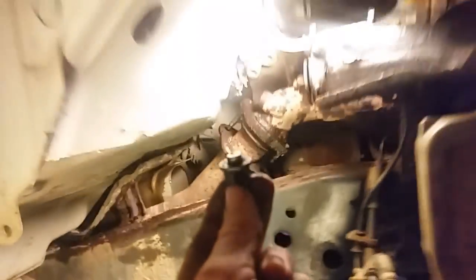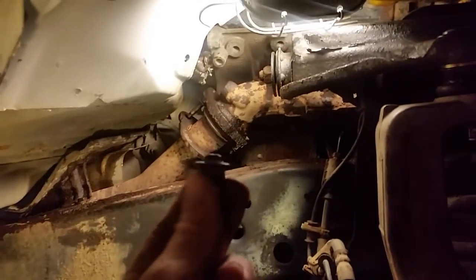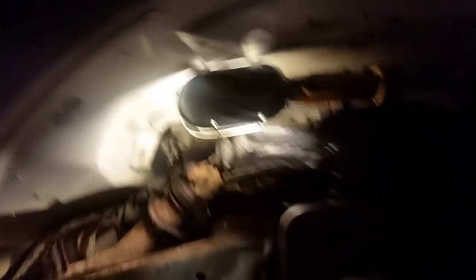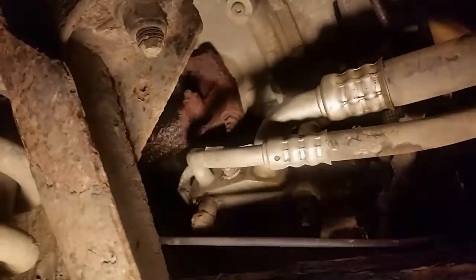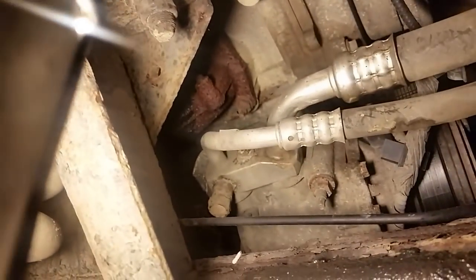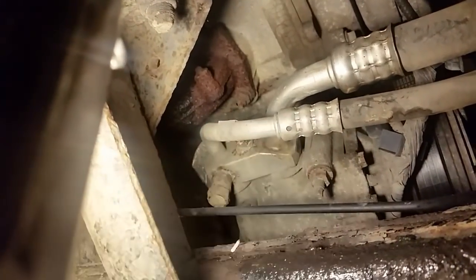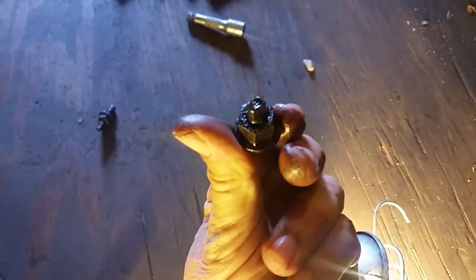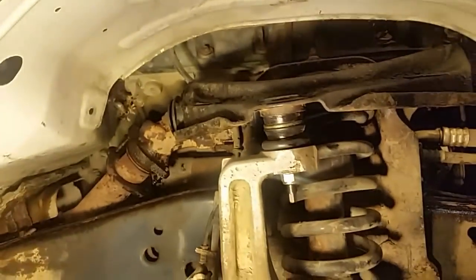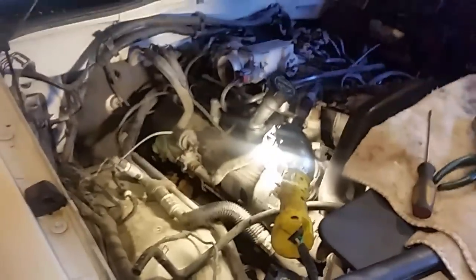I'm actually going to do this over the next couple of days. I worked on it last night, I'm working a little bit today, and I'll probably work a little bit tomorrow. Maybe I'll get this manifold off, and when I do I'll give you guys another look at it. The biggest obstacle I've got right now is that air conditioning pump — you can see the manifold sticking right up there above it, that one bolt, and I'm not sure how I'm going to get it off. Right there is the bolt — you can see it right there. These bolts are all half-inch. So I guess I'm going to take a long break and come back tomorrow or later tonight and finish taking this off and give you guys an update. If you're doing a 4.6 manifold job, just hang in there — you'll slowly get it done. Just work away at it. That's it for now. Thanks for watching, I'll see you later.